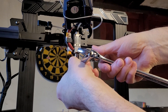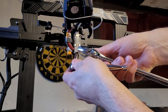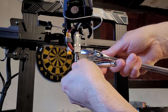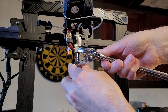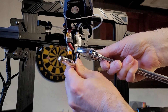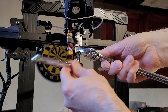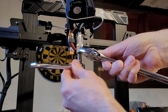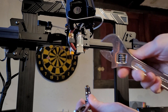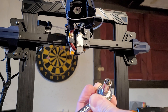I've got the ratchet — I had it set to tightening so I'm switching it the other way. Now I've got a hold of the block so it won't move, and I'm rotating counterclockwise. There it is — it has just cracked loose, so I'm unthreading it. I won't touch it right away once it comes off because it's going to be very hot. There we go — it's off! It looks good and dirty on the end there. That's the removal.